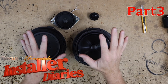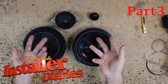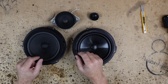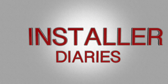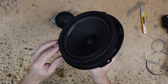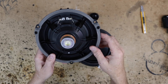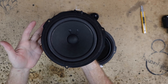At some point during one of these shows someone asked: why would you replace your factory speakers? Well, let's take a look at what is in this shaker system from the factory. We'll start from the back. In the back we have this speaker right here — a paper cone with a foam surround. It does have acoustical foam that's going to allow it to marry up to the rear deck. It uses a neo magnet and the basket is made out of plastic. What we're looking at here is that this is paper, and it's in the rear deck of a car.